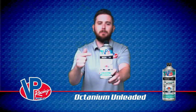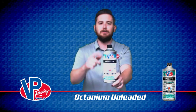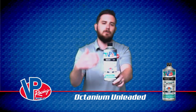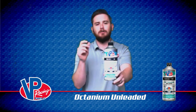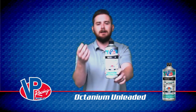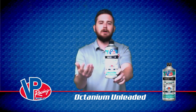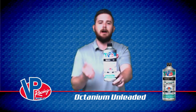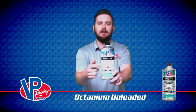One thing we do with this product is we also listen to feedback in the industry. With other people using these metal can type additives or other additives highly concentrated with MMT, you get that rust colored coating of the manganese when it oxidizes on your spark plug. So what do we do about that? It was pretty easy for us. We have a proprietary PEA, that's a polyetheramine detergent, that we added to this product.